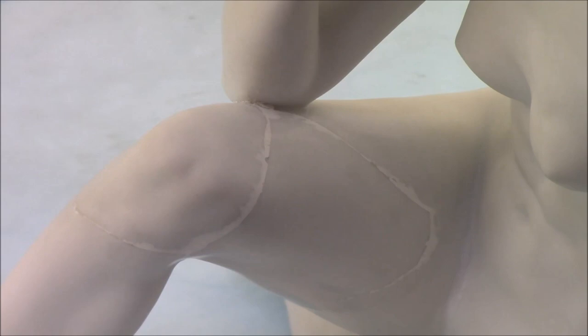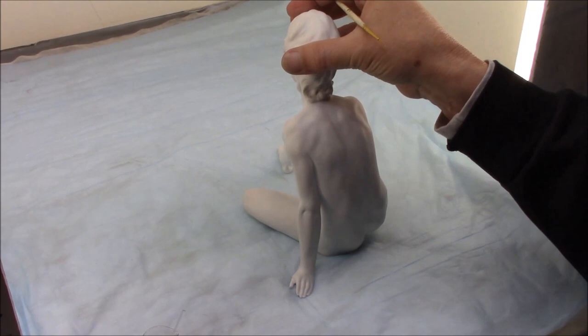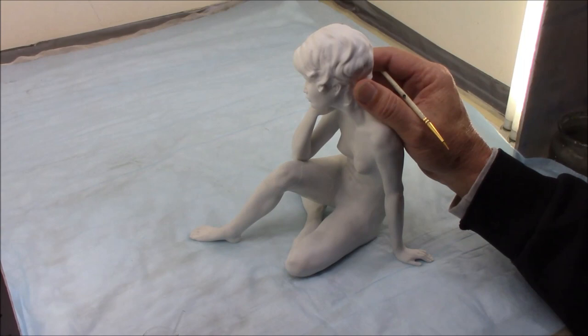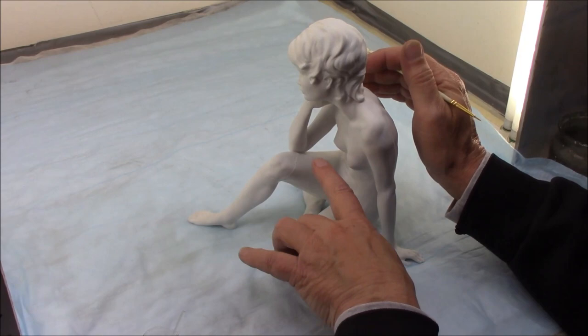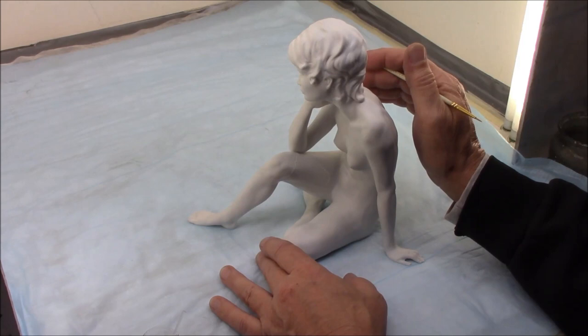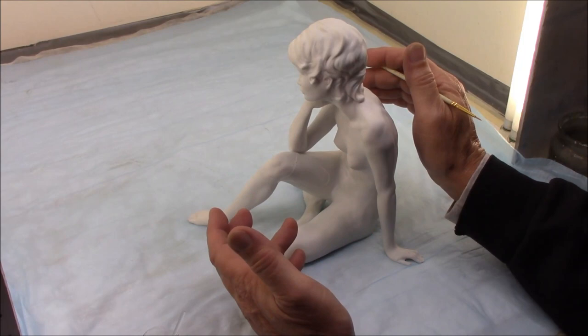So one method I'm going to show you today of how I do color matching is find a spot on your repair that is not close to... This has a cold glaze on top of it, and it's been sanded so that the paint will stick to it. And if I do my color testing on top of the cold glaze, I have to wipe it off. And at some point, I may compromise the finish with the solvent, or there might be enough tooth in the cold glaze that I can't really wipe it all off.